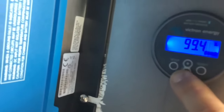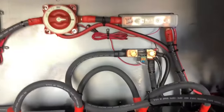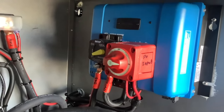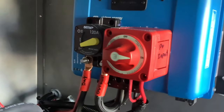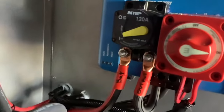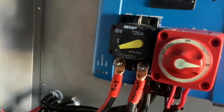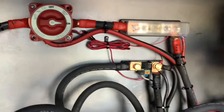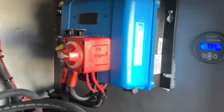These guys have a touchscreen system on the inside, so this monitor will be redundant — you'll have this information on the inside screen as well. Turning this way, this is the solar controller, which takes the solar power and converts it to battery power. We have a main cutoff switch for the solar panels — the red switch — and a main resettable breaker in yellow. We have a separate switch just for the solar if you need to turn the solar off independently.